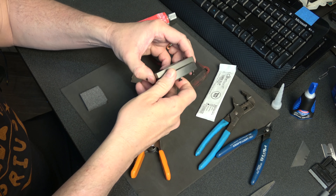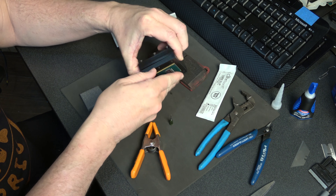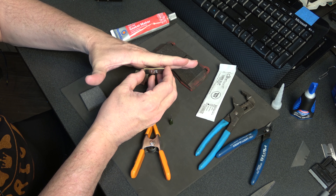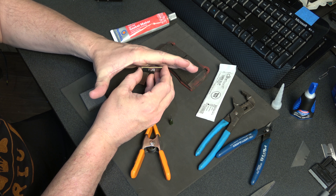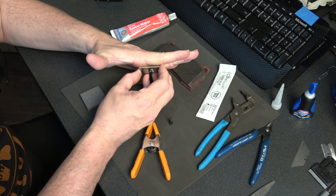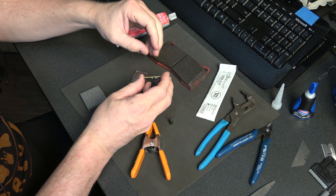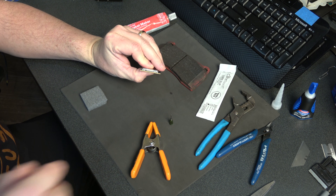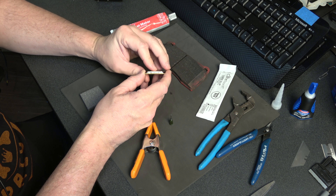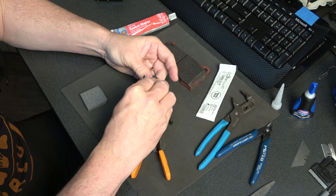In the past we've shown you how to relid using the delid die tool, which gives you a nice flat surface to mount to. The problem is when you don't have a jig like that, the substrate on these processors is probably going to bend down in a concave shape. When you push the processor down into the jig you get it to hold straight, and you get your heat spreader down and your Z height correct. When you just use a clamping force in the middle, you're pushing it down away from that substrate.